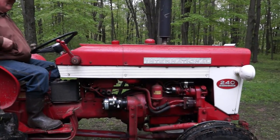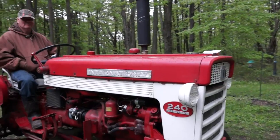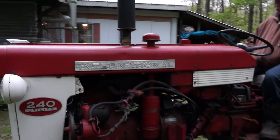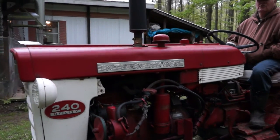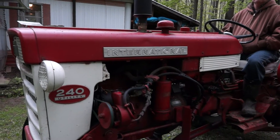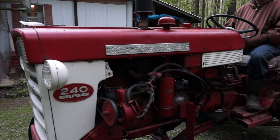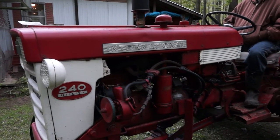In truthfulness, we actually had it started and knew it would start. We spent the last two hours putting the carburetor on and off three times. For reference, on a tractor like one of these 240s, in order to get the carburetor off, always take the air cleaner out first — it's a thousand times easier. It's only two bolts. With this retrofit universal carb, the reason we took it on and off three times was it wasn't responding to throttle very well. We cut the shaft on the inbound engine side but didn't cut it enough — it was touching. Then the throttle lever itself we had to bend a little bit, because the throttle linkage to the governor on the front was hitting the housing. We could also grind that rod down, but we don't have a grinder handy.